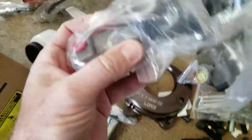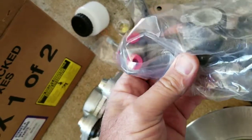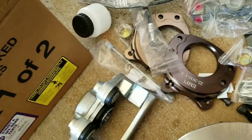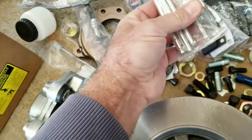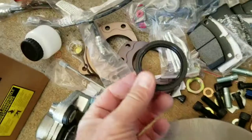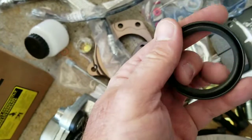One thing that's a big concern is that it has only a single reservoir master, which is not so great to me. I think they should have put a dual reservoir master on this, especially when you're going to disc brakes and you're worried about safety already. If your rear wheel cylinders go out, you're in trouble. It's not likely that the front ones will go out when you put disc brakes on — they're much more reliable than wheel cylinders.